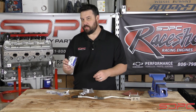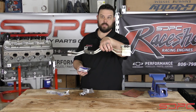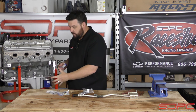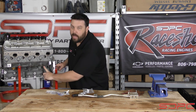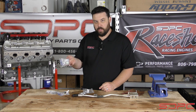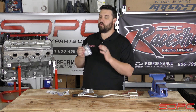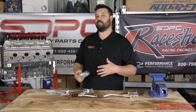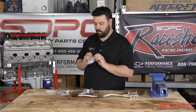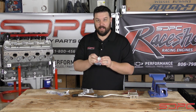On the LTs, one last thing: the truck engines will have a setup that goes up to the radiator. The cars, on the other hand, have it all contained in the back and actually use a coolant plug in the block. If you remove that system, you need one of these plugs — we sell them new right from GM. They even come coated in thread sealant, really easy to use and install. Most of the time there's not even a torque spec for it; just get it nice and snug because the thread sealant will do the job. It takes a 17mm Allen hex head.